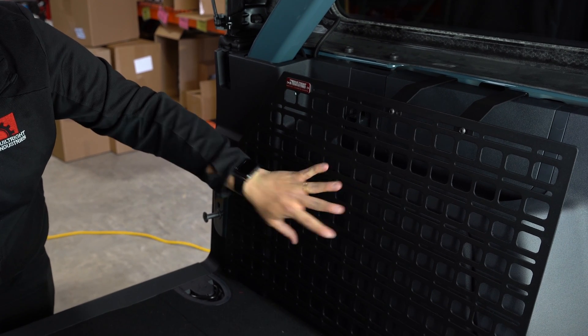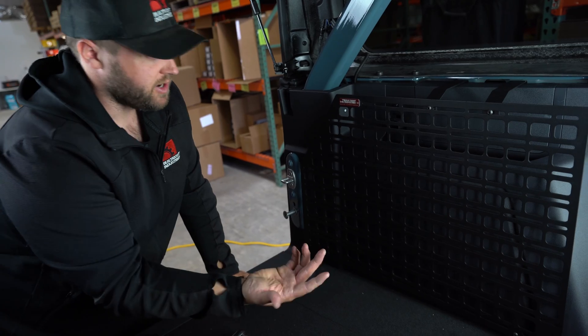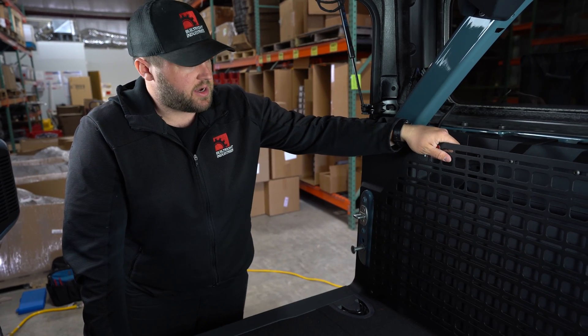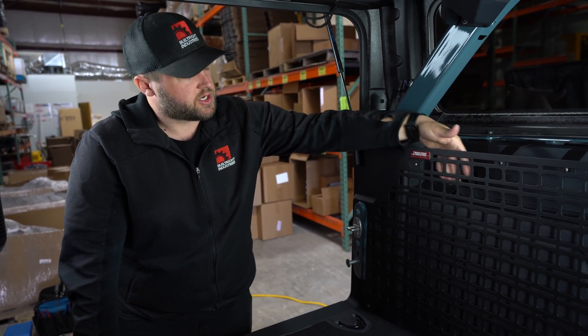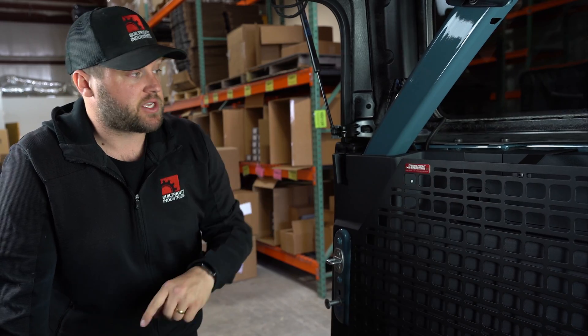The system is extremely sturdy now. You can go ahead and install your accessories. If you're bolting things to the panel while it's in the vehicle, I recommend using our MOLLE nuts, which give you a threaded feature so you don't have to fish a traditional nut to the back side. Alternatively — and this is what I prefer — just use four bolts, take the panel out, configure it the way you want, and put it back on. The passenger side uses exactly the same parts, just mirrored. If you have a soft top, it'll look a little different behind the trim but the end result is the same. For any questions, comments, or feedback, give us a call, shoot us an email, or find us on Facebook or YouTube. Thanks for watching.